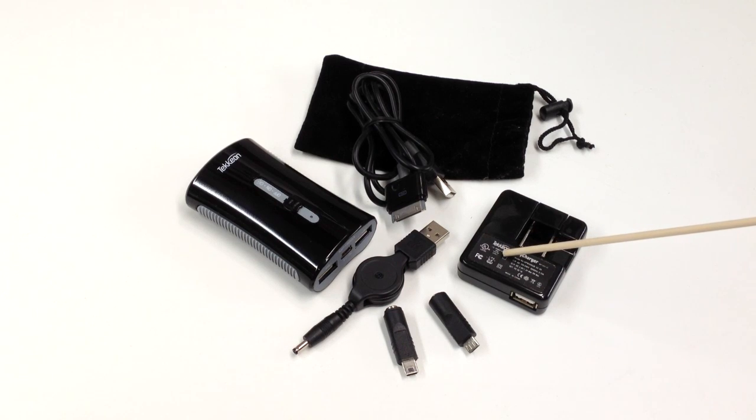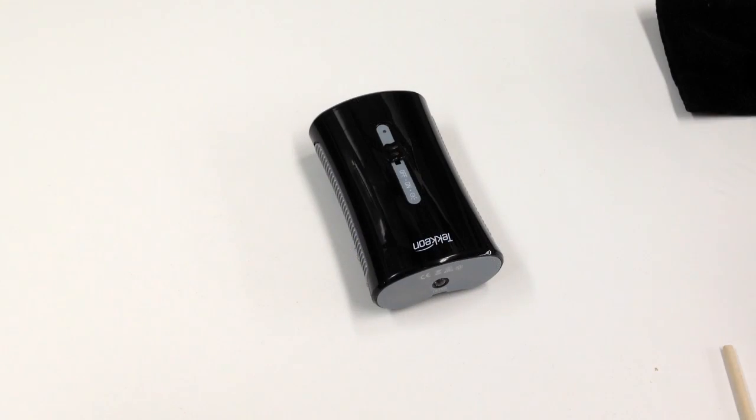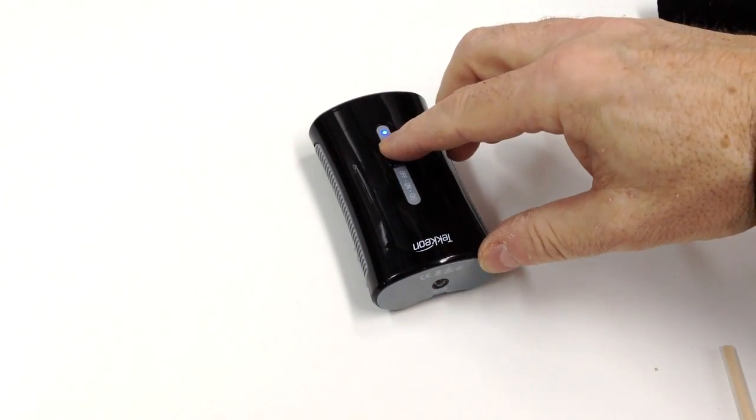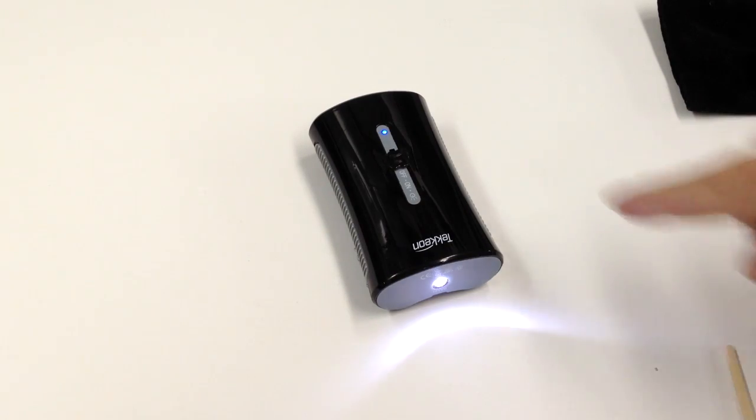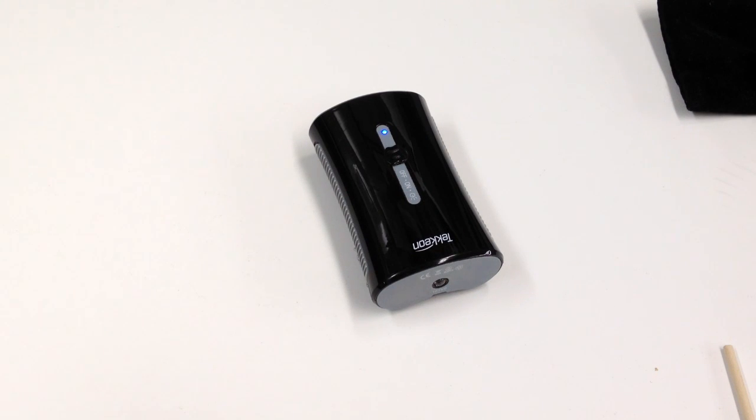When I purchased this in 2011, the total price on Amazon was about $56. Considering the charger alone is comparable to the iPad charger at almost $30, and cables run $5–$15 each, this is a spectacular buy. The switch on the battery pack has three positions: off, on, and on with a small flashlight. The LED glows blue when fully charged and is supposed to turn amber below 20%, but when used with the Airstream it goes from blue to exhausted without going through the amber stage — related to the amount of current being drawn.